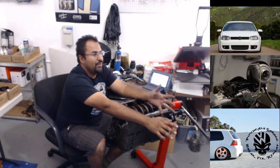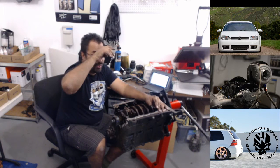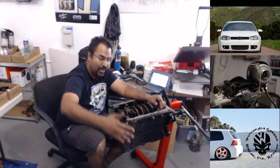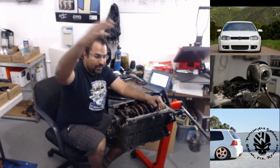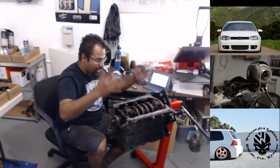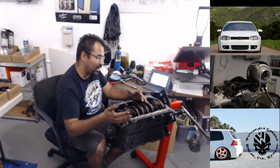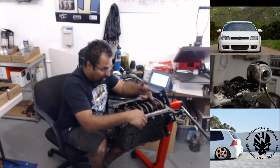It's probably the most open source tuning. What's really cool is it's upgradable. You can literally go from your stock turbo to a K04, K04-23, to a big turbo, to a monster turbo, or if you want E85, they will dial it in and get it done right for you. Especially if you have specific mods, like instead of just a cold air intake, maybe you did water meth, they got that.